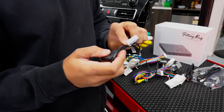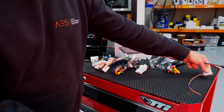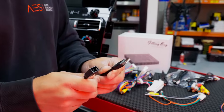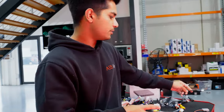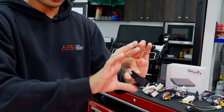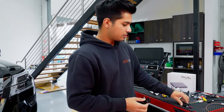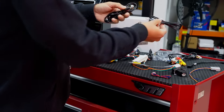It also has a provision for a SIM card, so you don't have to worry about hotspotting your phone or leaving a dongle in the car — you can pop a SIM right into it. There's also a hazard light connector and a reverse camera input. There's a USB retention harness included, but our kits won't be using that. Instead, we've designed little flush mounts that go on the bottom section of the center dash, replacing one of the blanks, giving you audio for Apple CarPlay and USB charging.